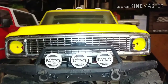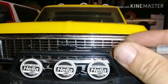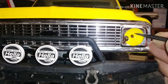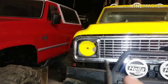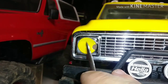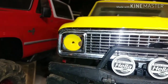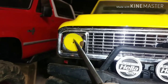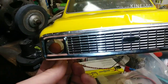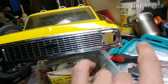We've got the grill back on the truck. Just used a little pick to find center — this one line right here in the middle of the bow tie, just below center of the bow tie, straight across: that is center for up and down. Then it's just a matter of left to right finding center. I'm going to drill this hole out slightly larger than the three-quarter-inch hole in the grille, that way we can fit the whole headlight assembly through the body. The glue I use will hopefully reach through the body and make contact with the grille as well. So we've got the body all drilled out, grille reattached, took the grille off to drill the body holes, reattached it — a little bit off, so I had to go back in with the drill to make sure it was all good.